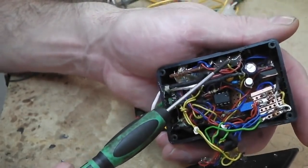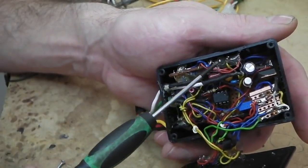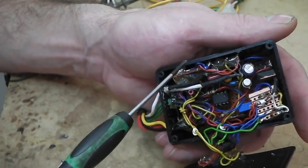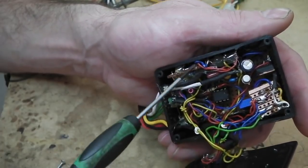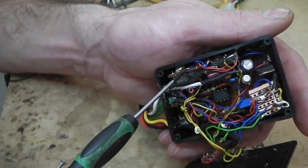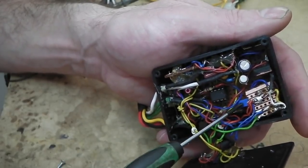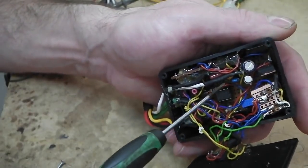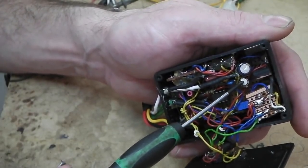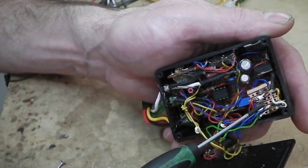Here is the second timer circuit, that's the 555 timer circuit, on a separate board, stuffed in the side, a bit of glue gun holding it in, and that talks to the safety relay. The safety relay comes on, activates that 20 second delay we're talking about. The heart of it's the baseboard at the bottom, a little trim adjuster there, a little trim adjuster there for what's called our hysteresis, a little drive transistor, a BC108, to drive this safety relay.